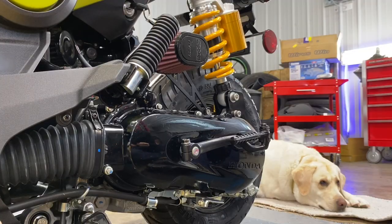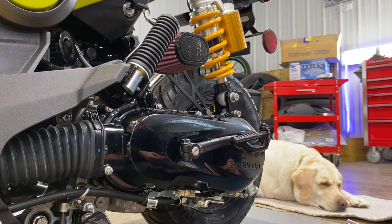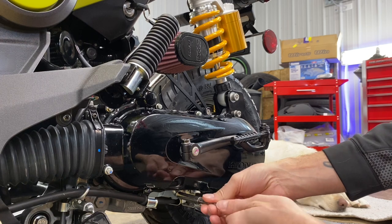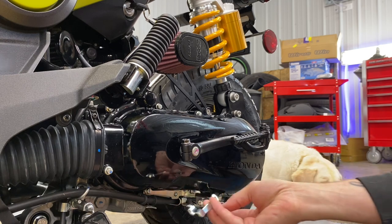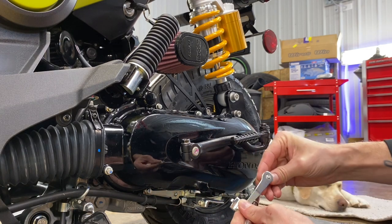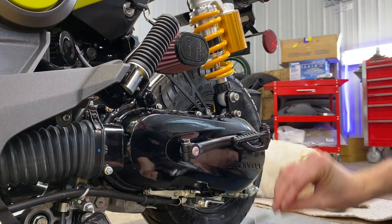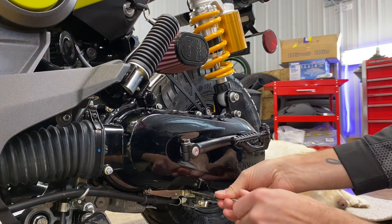What you're going to need to take off the left crankcase cover is an 8mm and also a Phillips. The first thing you're going to want to start to remove is your lower brake cable, your holder, your clamp. Go ahead and remove the bottom one — you can see the clamp itself comes off, and by doing this you're going to be able to access the two other bolts that are behind this plate. Go ahead and remove all this since we're down here.